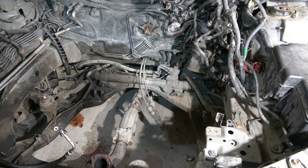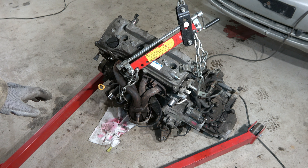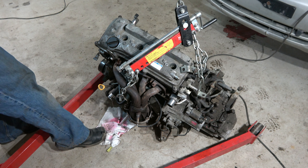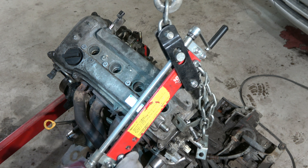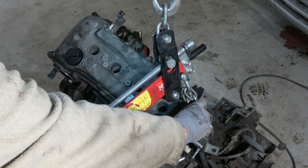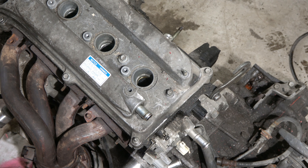Engine is now on the ground - excellent. We can also look at the engine bay to make sure everything is okay and inspect the mountings area. Now that the engine and gearbox are on the ground, some liquids can dry out - the coolant liquid. I have installed a cotton cloth in here. Then I remove also these chains away. These chains are now free - excellent.